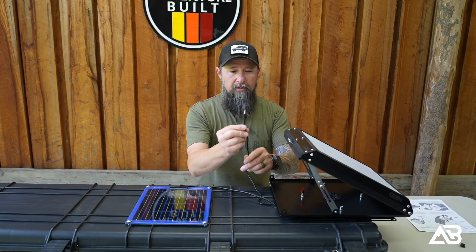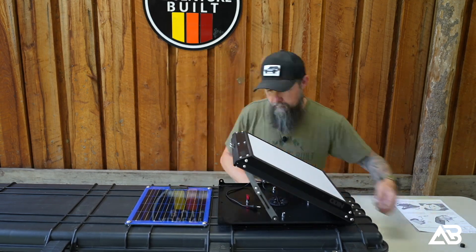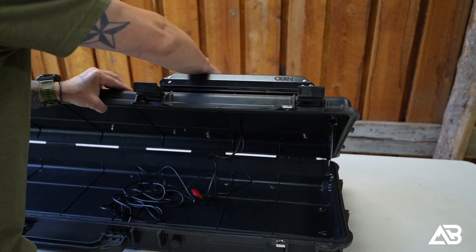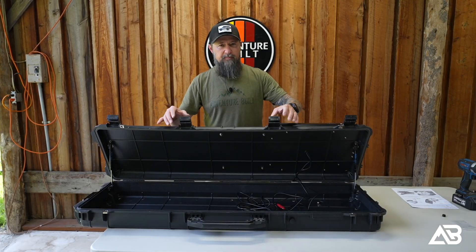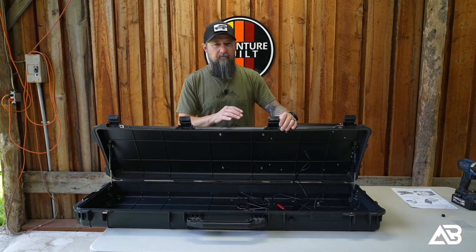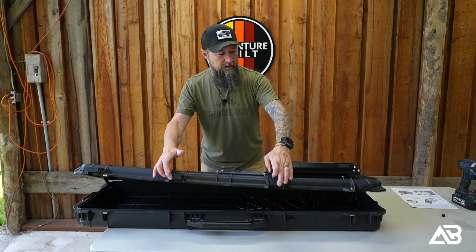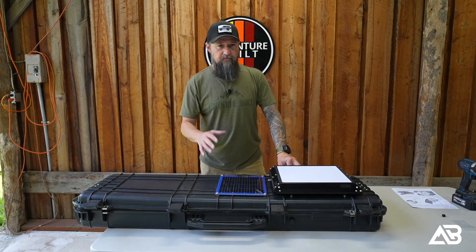Let's get it on the Apache. I'm going to feed the USB-C cable through the bottom plate. I'm happy to report that even with all this weight on the lid, it takes a little effort to open but it does stay open. However, I definitely need to get some heavier shocks for this. I think these are 10 or 11 pounds — I'll probably go up to 20, because even when it's halfway open it wants to slam pretty hard. I need to go up in shock pressure for this application.